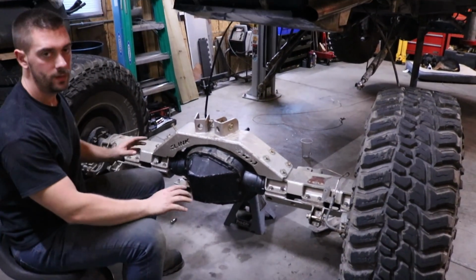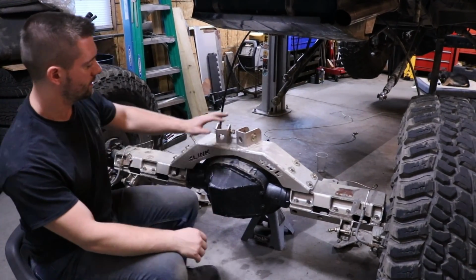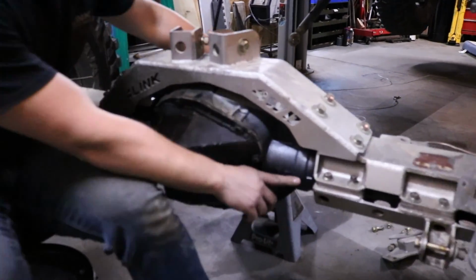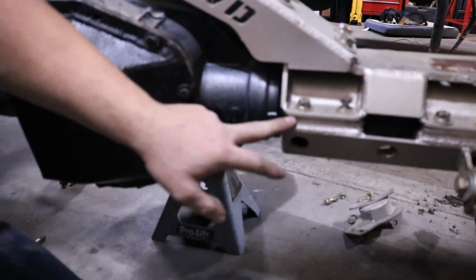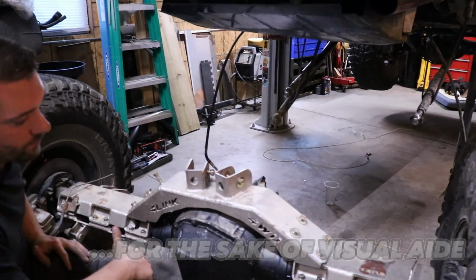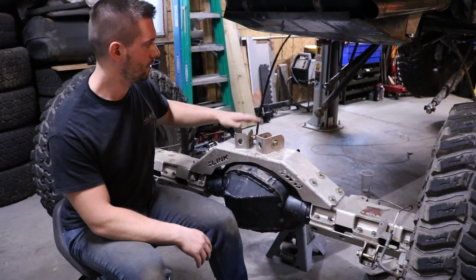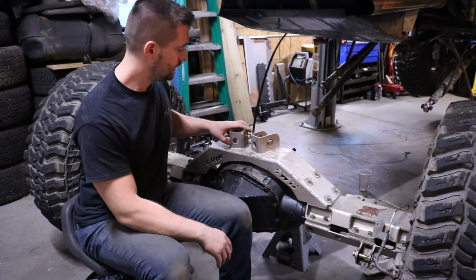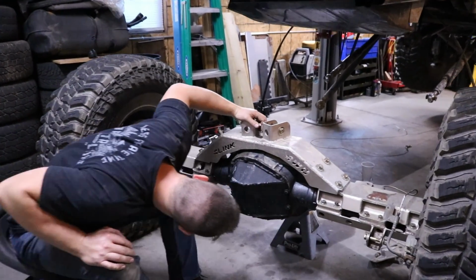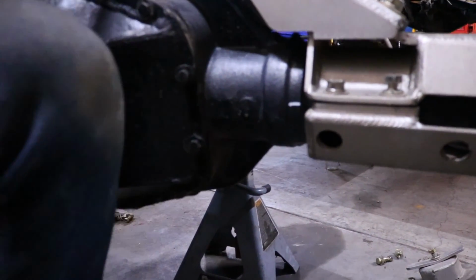Normally what you would do is put this under your vehicle, hook up your links, and I already have my angle set, and I have it marked on the casting and on the truss assembly itself. So I'm going to tighten it down without putting it under, just because it's easier to see what's going on here before putting it back under the vehicle. But yeah, so I'm going to set my pinion angle now. Actually pretty close already. So, sharp.